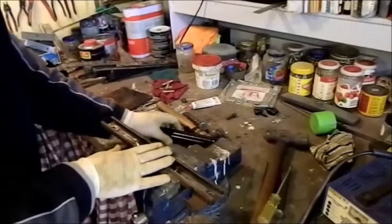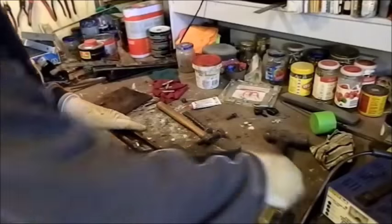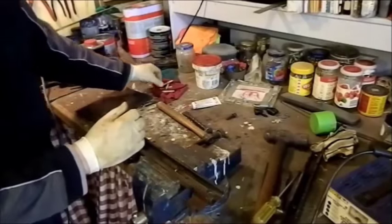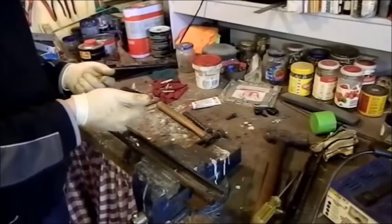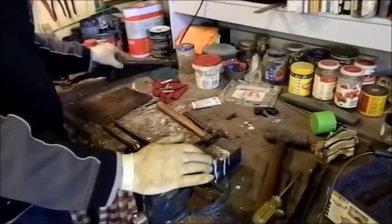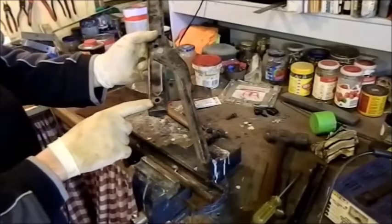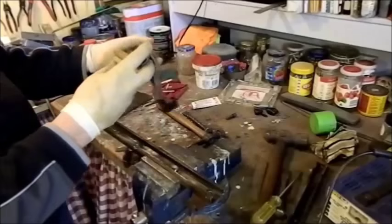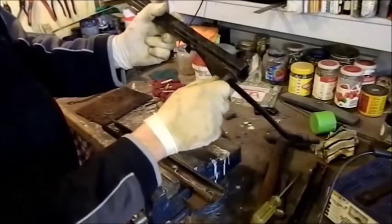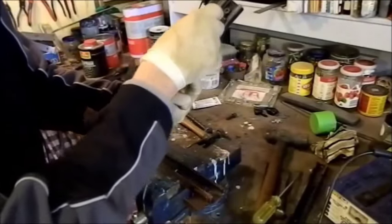Just so you can look at the seat runners now — cleaning up a few parts. That's one I've fixed up there, it's nice and smooth. These look fairly rusty but they're actually in really really good nick. It's just a matter of cleaning up the roller balls — I'm doing that on a bit of scotch brite. Putting these nylon spacers, or nylon guides, back in. They sort of run underneath here and attach to these cut-outs. Some of the runners have a square hole — the early ones seem to have a square hole. The square hole means there's a bit of slop, where the round one's going to fit much better. This is a very good one, nice and free — I'll lubricate that and clean it up.